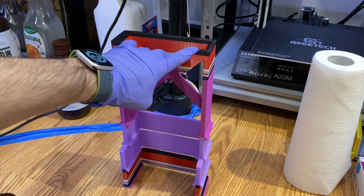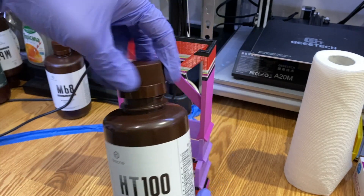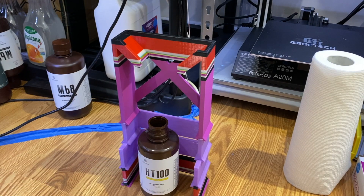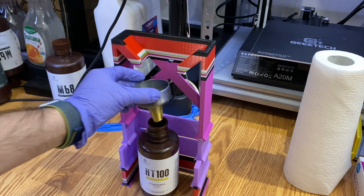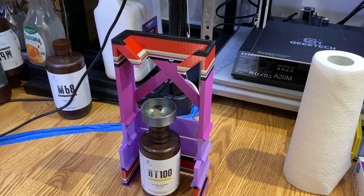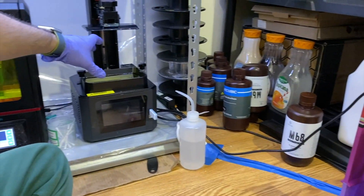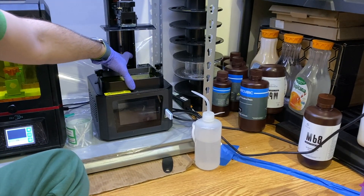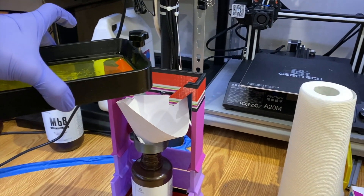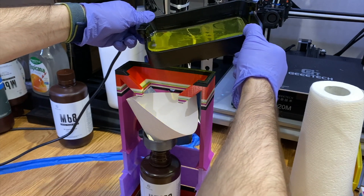I have the V-shaped holder and this is the entire body. I'm going to open up my resin bottle, put it in here, and I will put my 3D-printed housing on it. Then I will also put this filter, align it. Now I will remove the vat from the printer, bring it in — this is the vat holder — and pour this one into the filter.